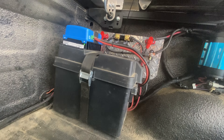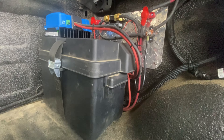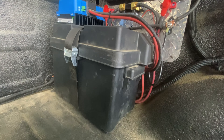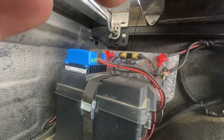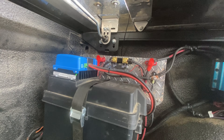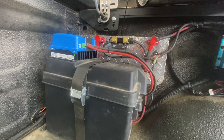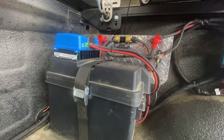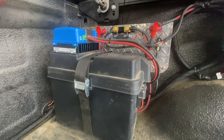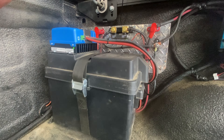The placement of our spare battery really didn't change — the mounting and a couple hookups did, but the battery is still there, same battery size, same battery box, still fits where it needs to. One thing we had to change was our existing mechanical isolator, which allowed our alternator to charge the two batteries in the truck plus this battery in the bed, while isolating this battery when the truck was off — so even if we ran it completely dead, we'd still be able to start the truck. I'm happy to say it functioned exactly like it should have when it died on us.